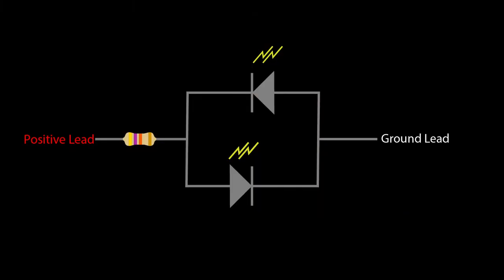Here's our diagram — pretty simple. I've got my resistor in series with both my LEDs in parallel. The critical thing is that each LED goes a different direction, and that's what gives us the logic probe functionality. When you get your LED out of the envelope, you'll notice one leg is shorter and one leg is longer — that helps you understand which is the anode and which is the cathode. If you want to understand more about that, do a Google search or check the textbook to understand which does what and which way current is going to flow.